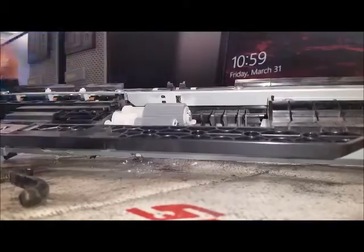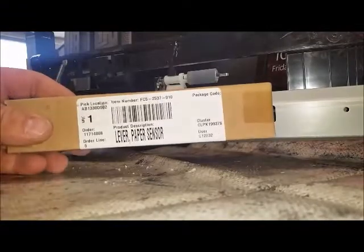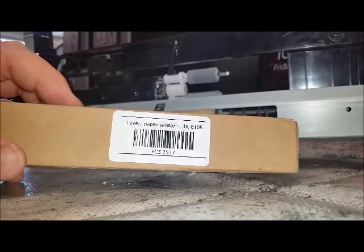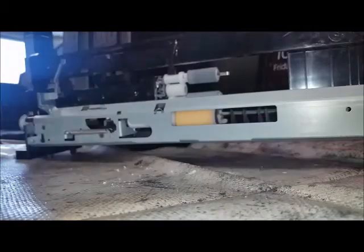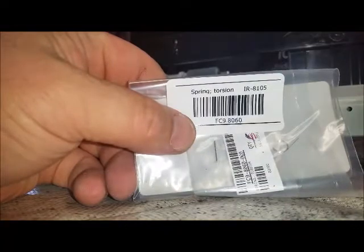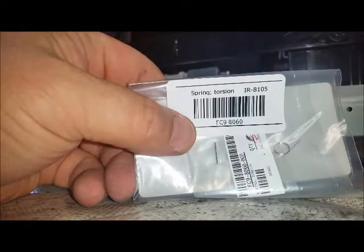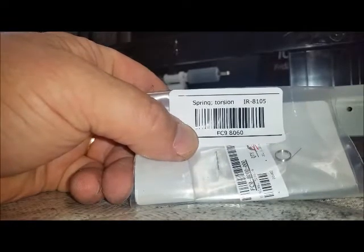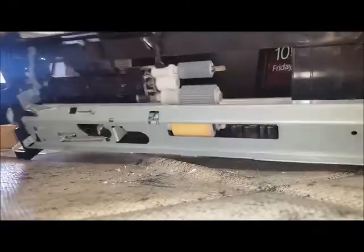So the parts you need would be this sensor lever, which is FC52537. Sometimes the spring gets lost too when that breaks and the whole thing pops out. Here's the part number for that spring — FC98060. You can order that and that should take care of your problem.